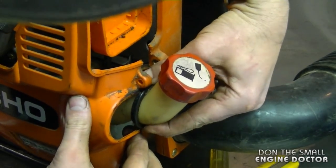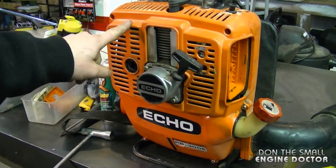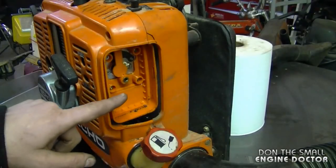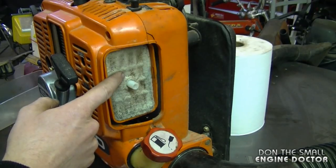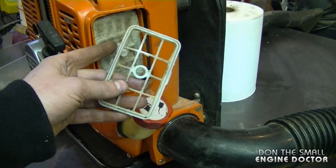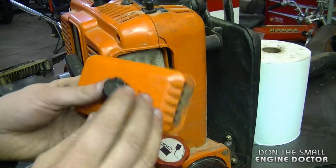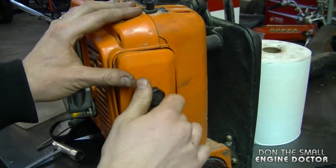Make sure you line up the grommet into the plastic shroud as well. All together there are five screws that hold the shroud on — two up top, one over here, and two at the bottom. All that's left to do is reinstall the air filters and the cover. The part number for the thin filter is 130-317-03460, and there's also a foam filter that goes on top with part number 130-310-03460. Once you have them, put this cover back on with the holes down below, and screw it back on. Thanks for watching — hopefully this video will help you repair your leaf blower.